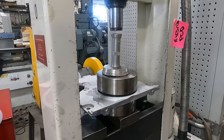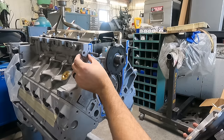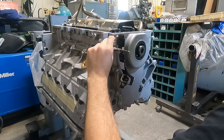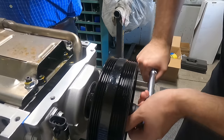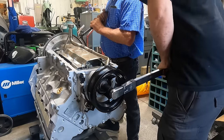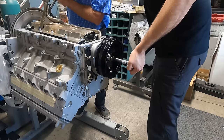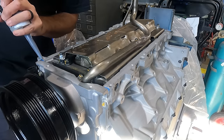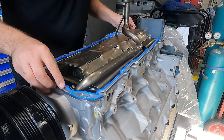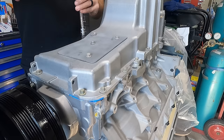The rear cover is reused, but a new rear crank seal will be installed by simply pressing the seal carefully into the cover, using a bit of lacquer thinner as a lubricant to make it go smoothly. The rear cover is carefully installed to avoid damaging the seal, and the bolts are brought up just snug. Similarly, the new timing cover — which replaces my VVT timing cover — is installed and brought up snug, not tight yet. Using a harmonic damper install tool, the damper is carefully installed onto the snout of the crankshaft. Using a new ARP crankshaft bolt, we torque it to the proper specification. The damper being installed helps align the timing cover, at which point you can final torque the bolts, keeping the bottom face aligned with the pan rails of the block. All four corners where the block meets the cover should get a light bead of silicone sealer to prevent any leaks before the oil pan gasket is installed. I also installed the oil pickup tube with a proper new O-ring, and replaced the oil relief valve in the pan with a plug since I have eliminated the VVT and AFM. With the pan in place, the bolts can be evenly snugged up, and this engine build is nearing completion and ready for installation.